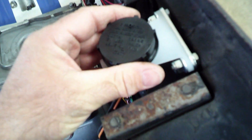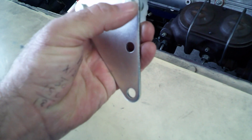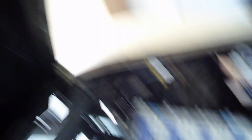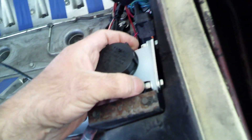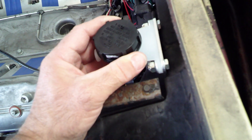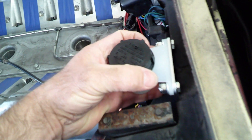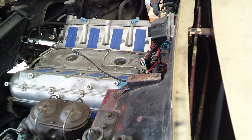There's no place around here really that it'll fit on the firewall. What I'm thinking is I'm going to install it here. I had to put the bolt heads on like that, and I'm going to go get some spacers that are thicker and just drill these two holes. If I locate it all the way down here, that'll give me room to still close the hood and this portion of the hood will sit in between here — I think it'll just give me enough clearance. I was going to mount it higher up but I think it might possibly interfere with the hood, so I don't want to take that chance.